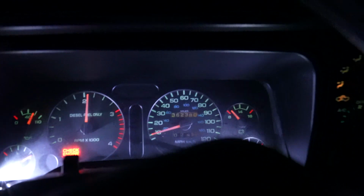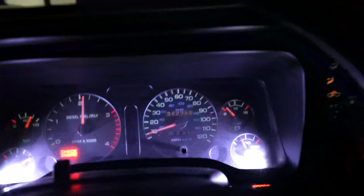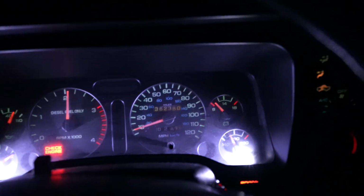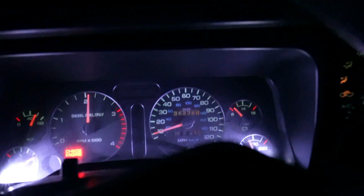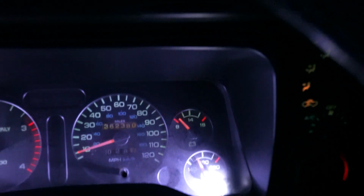Just when I thought things were turning around for the better, they got instantly worse. You can look at my voltage for the batteries, and they dropped down to 8 volts, and all my lights started to slowly go out. So no headlights at all, no light bar, no brake lights, no running lights, and no trailer lights. They all went out while I was on the highway, and the tachometer stopped working. So yeah, it wasn't a good situation whatsoever.